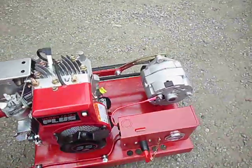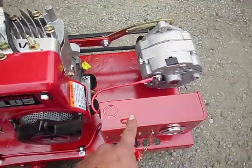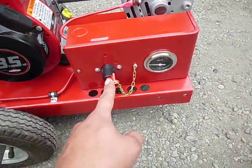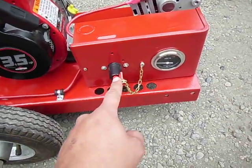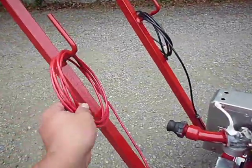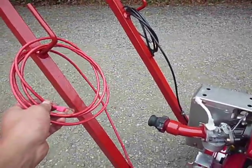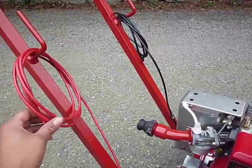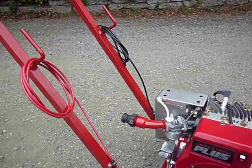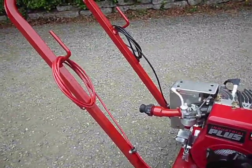I took the hot wire coming out of the back of the alternator, ran it into this little electrical box, and it runs to one side of this disconnect. Then it continues out the bottom of the disconnect through these eight-gauge wires. I've got a post or stud terminal on each end of them to connect to my battery bank. I'll probably add alligator battery cable clamps on the ends, but for my battery bank setup this is perfect.